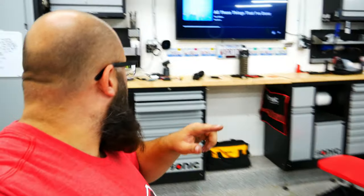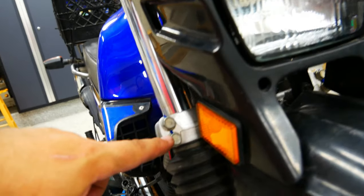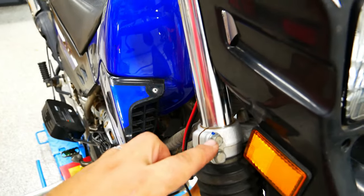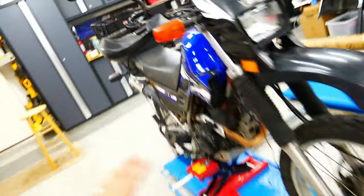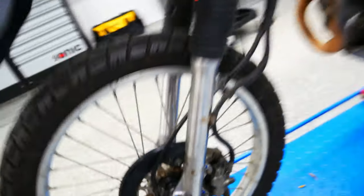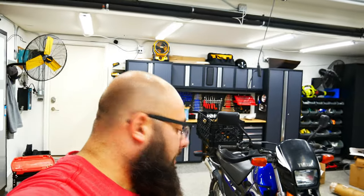So I'm going to tell you what I do — I mention this quite a bit on my channel. I learned a lot from a channel about two years ago called Del Boys Garage, and he recommended this thing called the cross-check. Basically what it is, it's like paint that you mark on your bike to visually see if the bolts you touched came loose. It also helps me remember what bolts I loosened that need to be tight and torqued down. What I do is always put a little dab on the top of bolts — it needs to touch the frame and the bolt — so when you walk up to the bike, you can visually see if that blue dot is inside or outside. Every bolt that I touched I put this cross-check on, and it also is a visual inspection for whoever's riding the bike that all the bolts are tight.